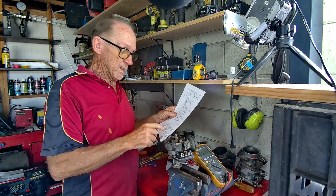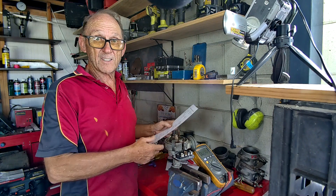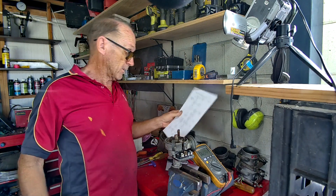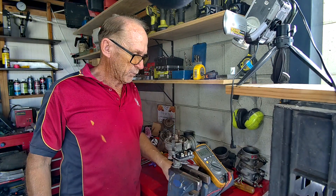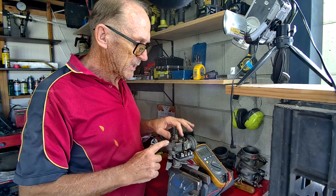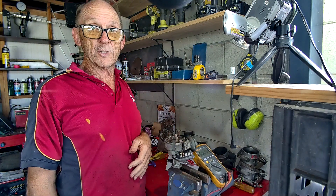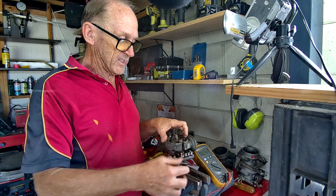Going back to the flowchart at the module: is the pickup coil pulsing? If no, replace it if you can get them. If yes, go straight to replacing the module - that's all it can be, or a bad earth. Check the earthing if you still haven't got a spark. That's very handy for novices, and I think I've pretty well covered how to test the pickup coil.